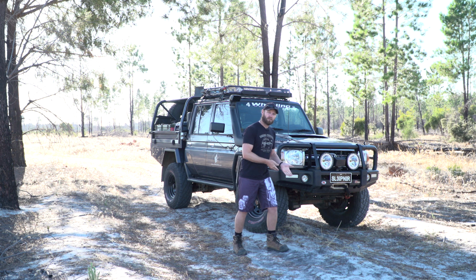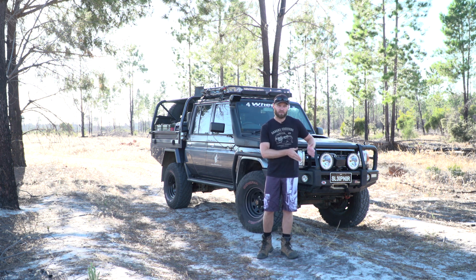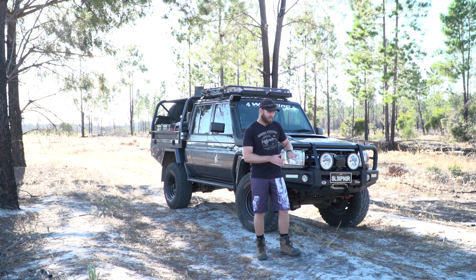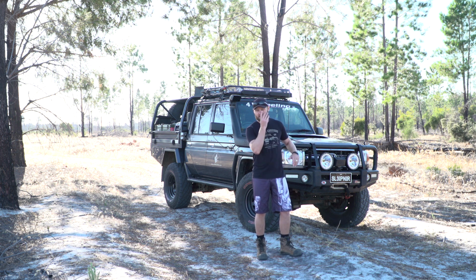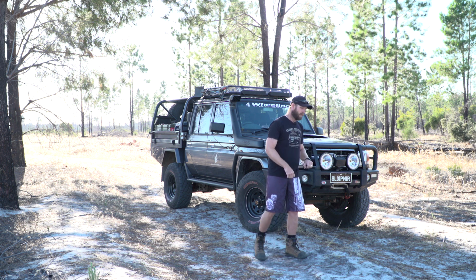When you're on solid surfaces and you forget to take it out of four-wheel drive and you start feeling understeer and steering gets really, really tough to turn, pull over off to the side of the road immediately. Even just get half the vehicle off the road onto the gravel, and if you're lucky, it may be able to get rid of that energy on the gravel. Otherwise, pull the whole vehicle over onto the shoulder of the road and just try and get it out of four-wheel drive. So that's all I'm going to touch on with the four-wheel drive and why you need to get out of it. But I can't stress to you enough, get out of four-wheel drive before you hit that highway.